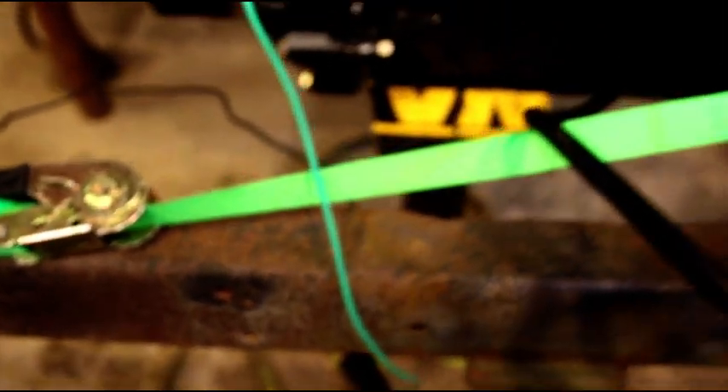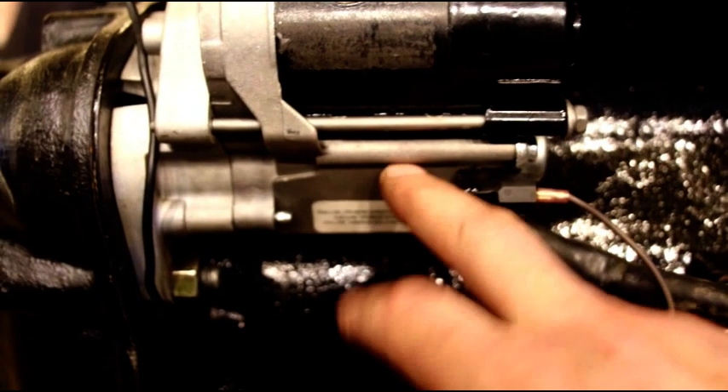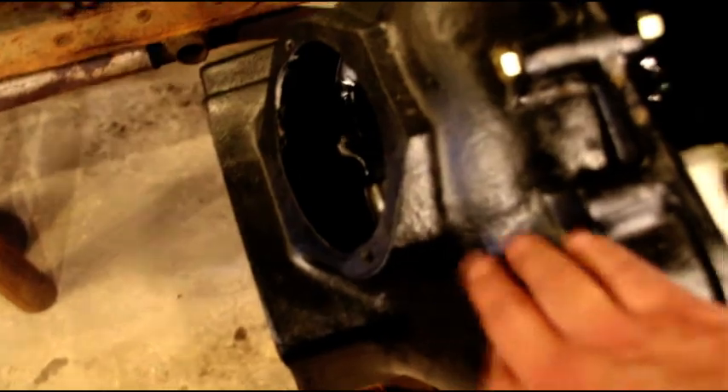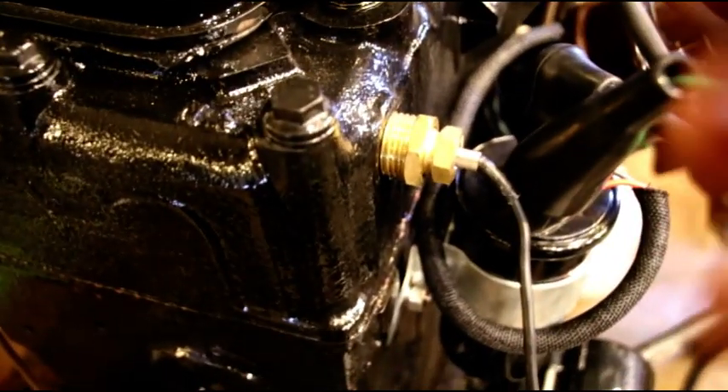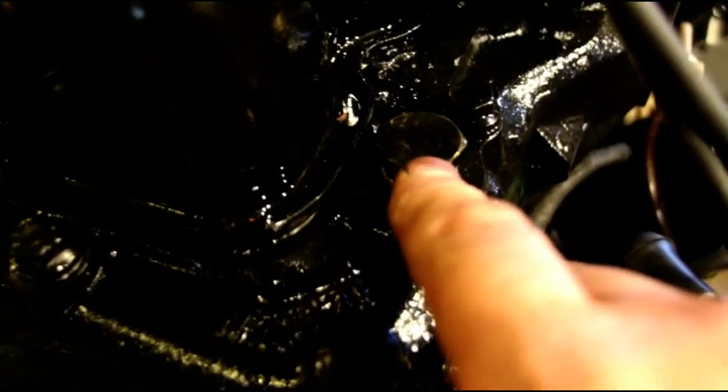I've got a battery cable to it and just an old foot starter to start this up, but this is what you'll bring your 12 volts to — you'll excite the solenoid and that starter motor will work perfectly. Now this is my startup bell housing — that's not coming with the engine. The starter will be there though. I'm going to drain the water out obviously. Here's your temp sender connector — this is my mechanical gauge just as a standby — there's a plug here if you need one.